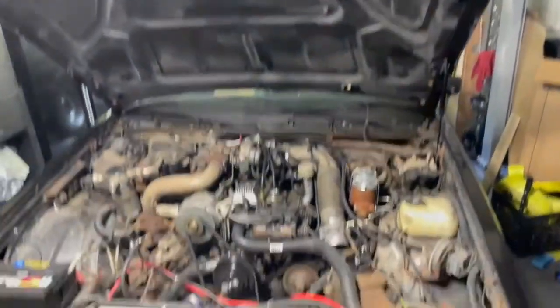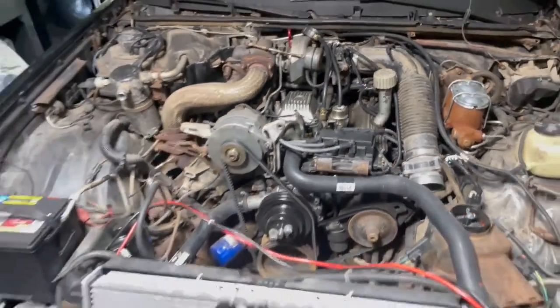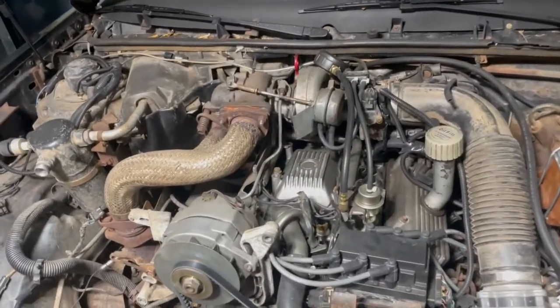Still a decision needs to be made on what goes in it, but we're sticking with hot air for now. If you're looking to do something like this, you've got to grind the area down well — I used a belt sander and removed all the rust scale and buildup around the area, then used the original JB Weld because it has the greatest sticking properties to metal. Let me know if you've ever done something like that before and how it worked out for you. I've also got the Buick back in and I'm taking a look at the fuel pressure regulator — the stock one is running about 35 psi, and I've got this brand new G Body Auto Parts adjustable unit to get it up to 45 psi, which is what the Extreme G chip calls for.